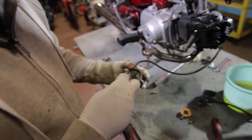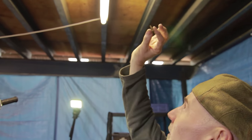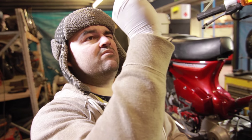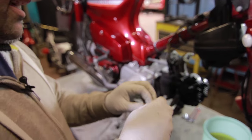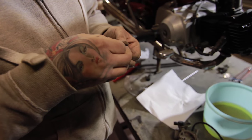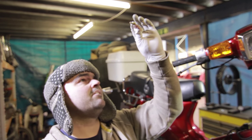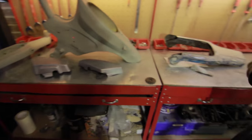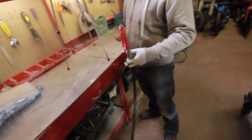What you're looking for — they've got little tiny holes in them. You can just feel it, but usually when you blow it through it'll clear because if there's a bit of fuel in there it'll shift. I'm really pleased I didn't do anything more with it and get it cleaned out, so I'm not dragging any crap any further. We'll just rinse that — I'll blow it out with an airline. If they're blocked, you can get an old bit of wire, pull a strand off and just poke it through — normally you can see straight through. Most of us can probably get away with cans of compressed air for cleaning keyboards.